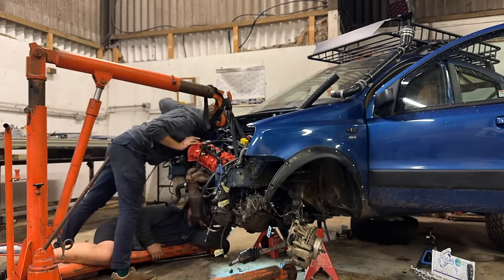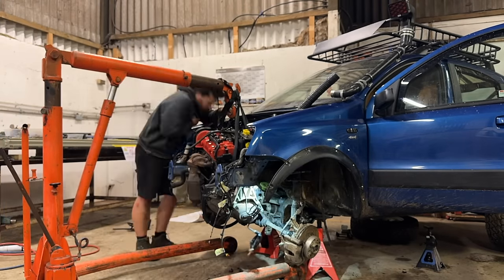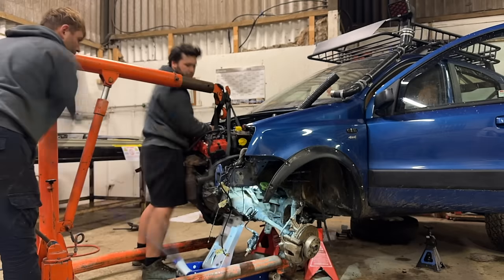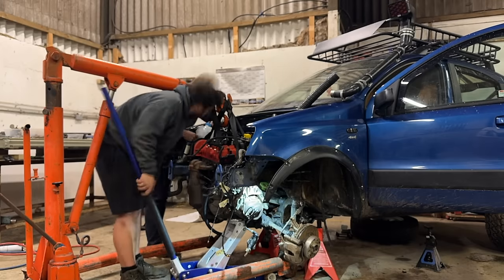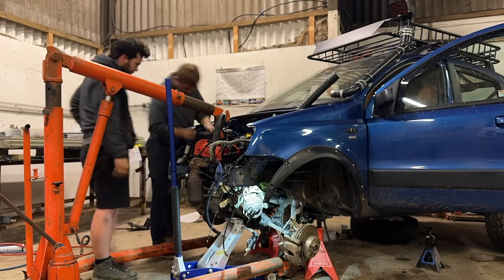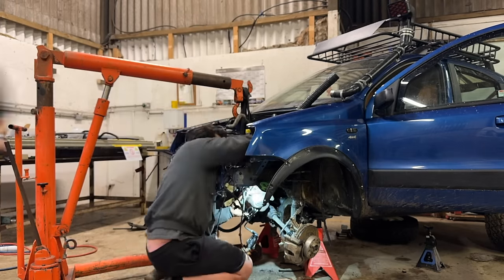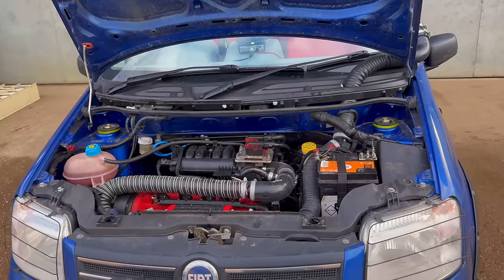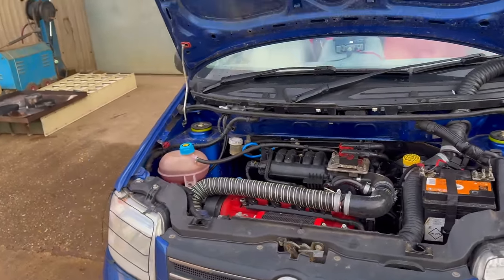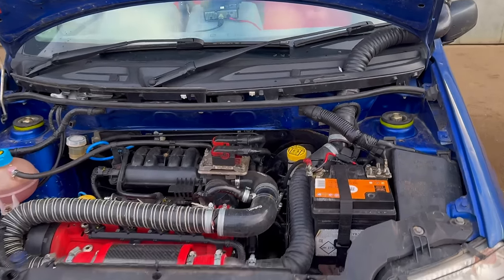To do the conversion you have to fit the ABS pump and the engine bay wiring harness, which runs into the dashboard, so the whole dashboard has to come out — it's a little bit time consuming but it is basically plug and play. You just swap everything out from the donor car. A YouTube channel called UK Panda 4x4 has a relatively detailed guide on how to do the conversion, and the UK Panda 4x4 Facebook group is also very helpful — great guidance overall.